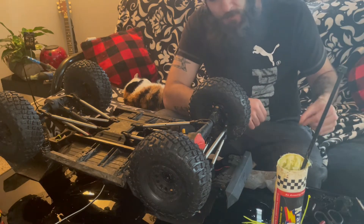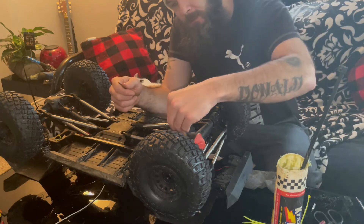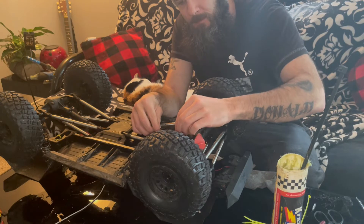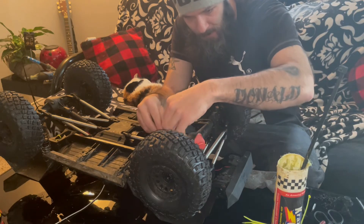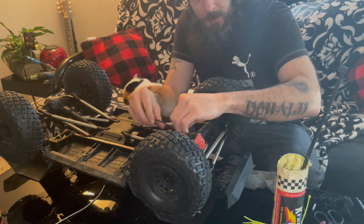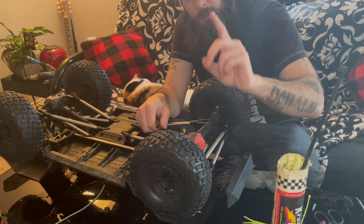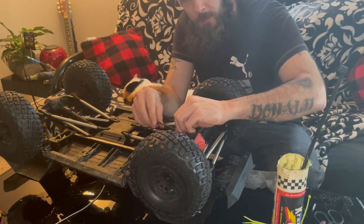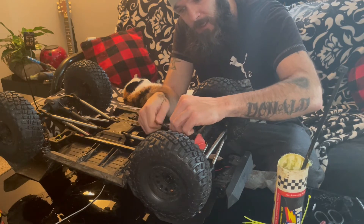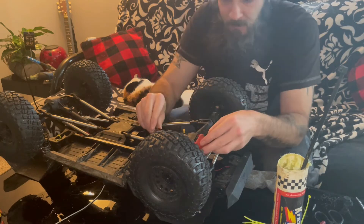For the average person who doesn't run in all that much water, you'll probably be fine. As you can tell by my table here, we run in a lot of water, so it's probably best for me to throw in that extra bit of grease. None of my transmission really needed it, but be warned — I would open that up and throw in some proper diff or marine grease, something better than what they've got going on in there, because it ends up being too liquidy.